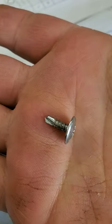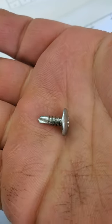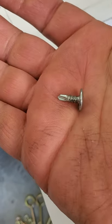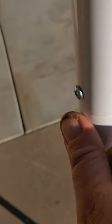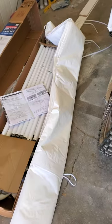The other thing is you're going to want to get some self-drilling panhead sheet metal screws — there's a difference between self-tapping and self-drilling. Self-tapping are just pointy and will probably work, but self-drilling will work a little easier. Get them anywhere between about three-eighths and an inch long, and put those at every place where there's a joint. Between those two things, this thing should be pretty much bulletproof.